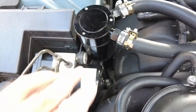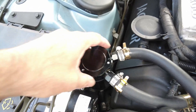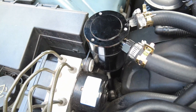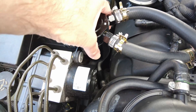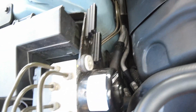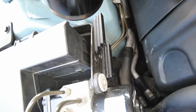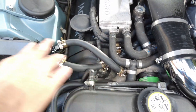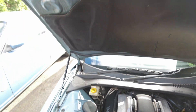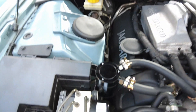We've now been able to properly locate the oil catch can. I wanted to make sure I've got easy access to unscrew it at any time. What I've done is build up a series of magnets on the side of the steel bracket there, and they are positioned such that they just hold the can in there. The hoses also provide some placement support, and finally when the bonnet closes we've got insulation which just sits on top and pushes down slightly on the oil catch can. Hopefully you can see the can is sitting flush.